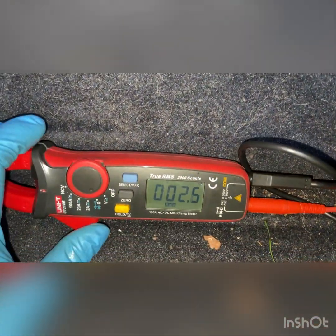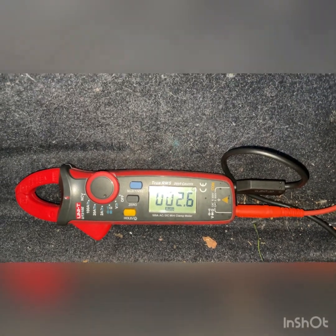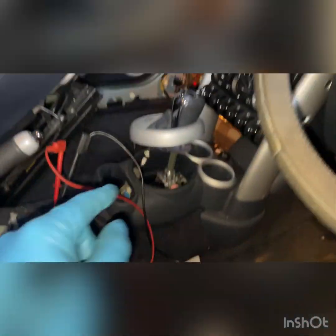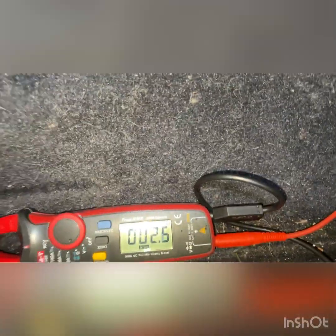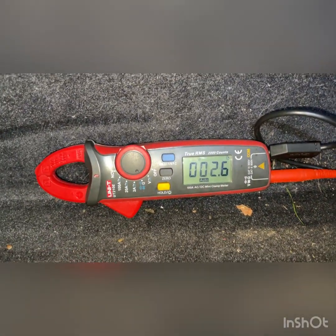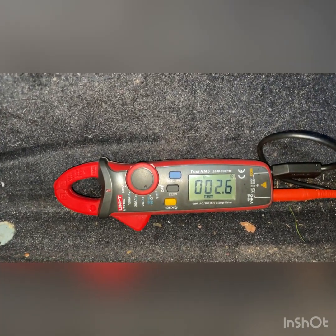So to me, there's resistance there. The wiring isn't an open circuit. It's not shorted together. That wiring from this connector all the way through the body around to this seat, to this pre-tensioner, is all okay. So what we need to do now is this control unit is faulty, so it's not gonna fault with this airbag or pre-tensioner when there isn't a fault there.